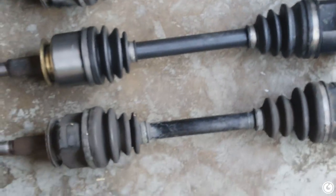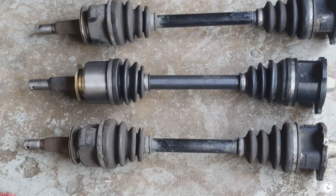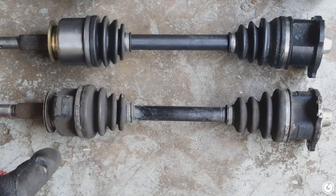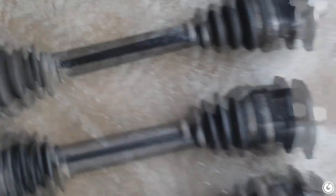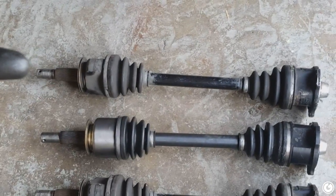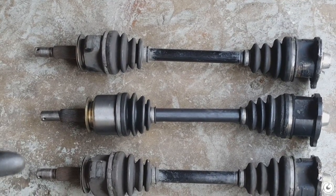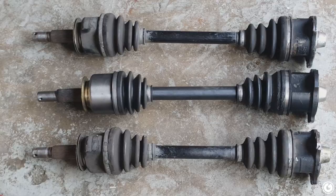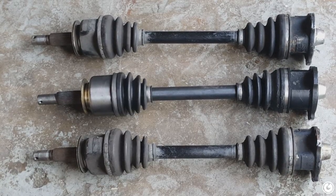Here's the Duralast one out, and here is the new one going in — well, used, good condition. I don't get it; they're the same length, they should be fine, but this new one is definitely binding like crazy. Something I didn't know — I was asking on the forums — the driver side axle is slightly shorter than the passenger side. The top one is the passenger side and these two are driver side. So it's a slight bit shorter. I thought AutoZone had given me a passenger side one, but that doesn't seem to be the case, so I'm still trying to figure out why this axle is binding.